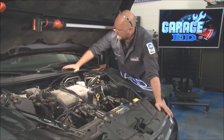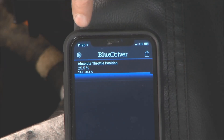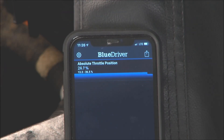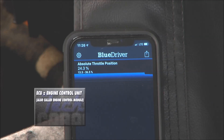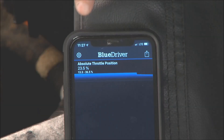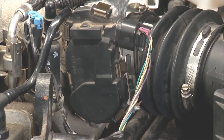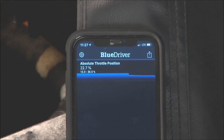We're going to start the vehicle up — go ahead Abonte, fire us up. You can see that as we start the vehicle we go from 34% open. The ECU is absolutely dedicated to optimizing fuel economy, and if you listen, the idle spools down. We're down to 23% — that's about a 20% swing on the position of that plate with the drive motor finding the optimal position.